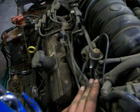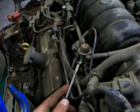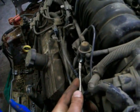Found something that might be interesting. In one of my other videos, I showed you how to relieve fuel pressure, and I didn't really have any pressure on it when I showed you. So we're going to see if this one squirts out any better. That was weak — they usually squirt out a lot more than that. Must be losing pressure somewhere. Oh well, you know how to do it at least. And you know where it is on the 97 LeSabre.